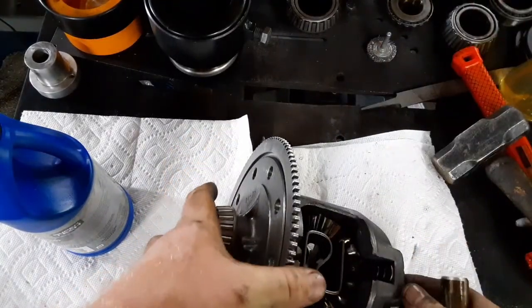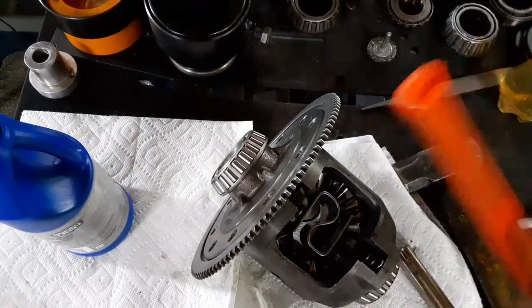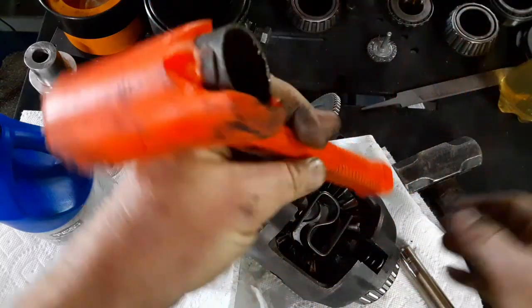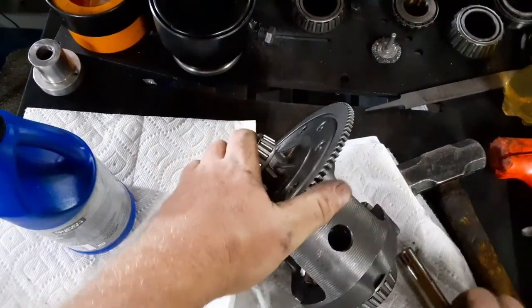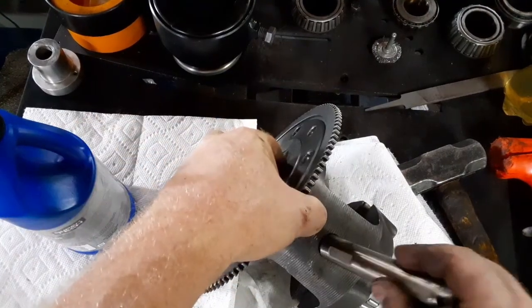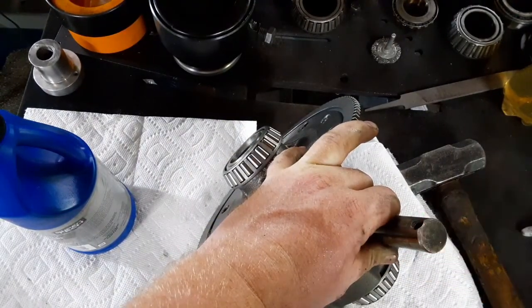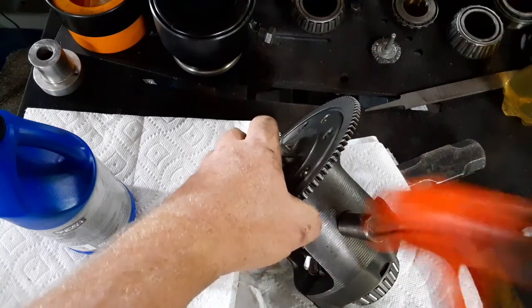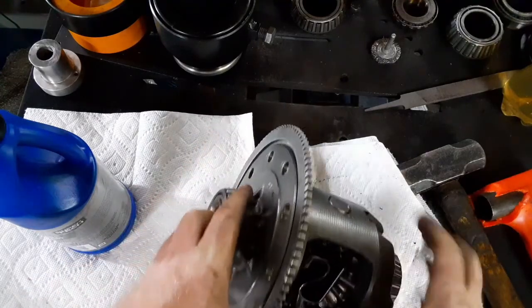Then once it's in there and started, you can straighten it out. Once you've got everything lined up to where you think it's straight, a good way to rotate it once the spring is in there is to take something soft like the butt end of a rubber mallet, put it on the gears like this and then hammer the other end of the mallet. That will rotate one of the gears which will rotate all the gears in there. You're going to be fighting against the clutches, so just take your time and don't hit anything with metal. Then once you think you're all lined up, slide your pin in - this is just to check it. It's a lot easier to adjust now than once it's in the car. So everything lines up good.